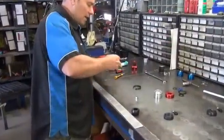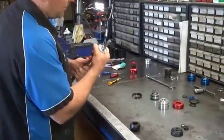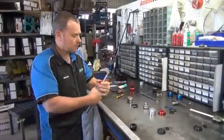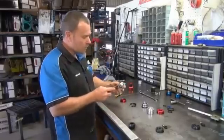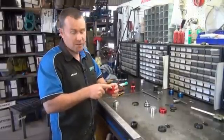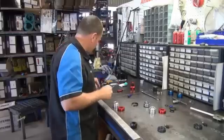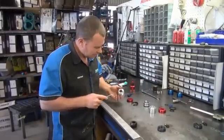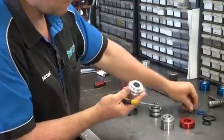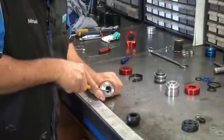Once you've got everything undone, it's best to try and take the whole thing off as a complete assembly. That way you've got less chance of mixing anything up. Always put the nut on top so you don't mix it up — it's got a nice little chamfer which will make putting it all back together easier. So pull that off. What you've got is one o-ring there — take that one off. You've got a seal in here which is your dust seal. Just get a seal pick and try and jam it in there and pick it out. And then inside, there's one seal on the top which is your blue seal, then there's an o-ring underneath. So that one's the o-ring.